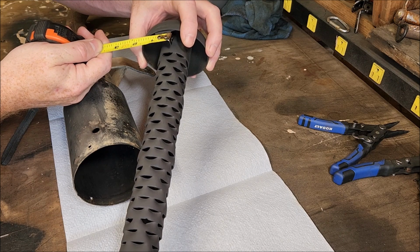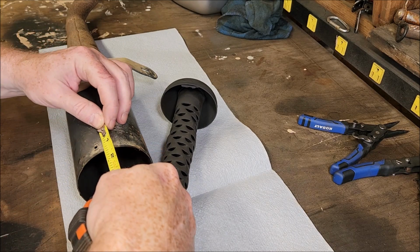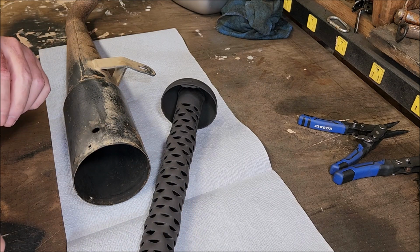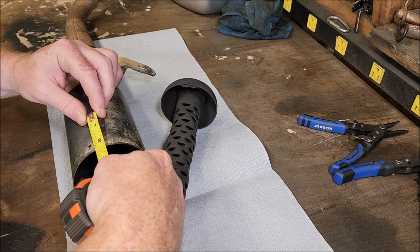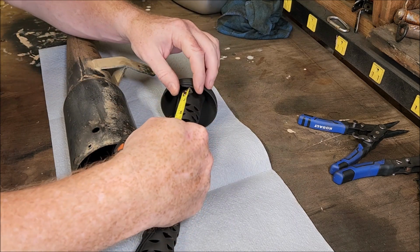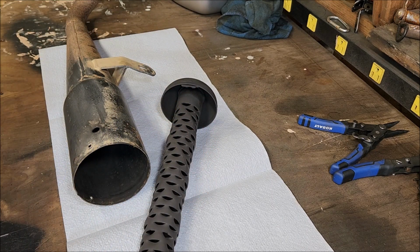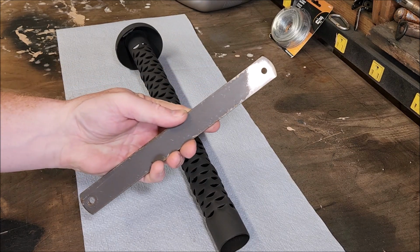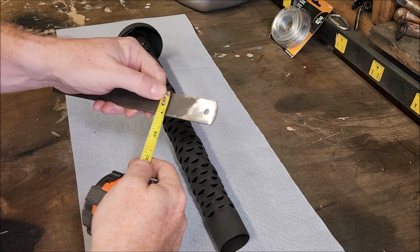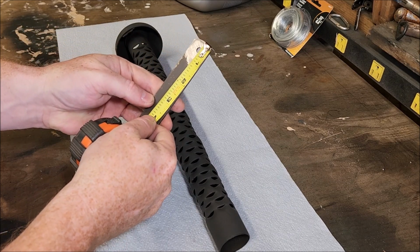I have a 3/4 inch tab. Not sure how long. The center of the hole is about 1¼ inches. So even if I went about 2 inches, I have a little extra tab, and I could grind it down from there. I found the 1-inch scrap in the scrap bin. That's 1 inch across. I can cut that any length I want. I guess I'll go 2 inches.